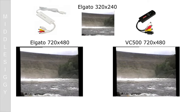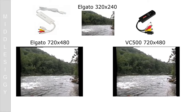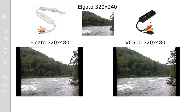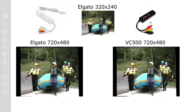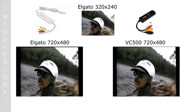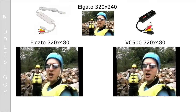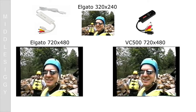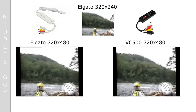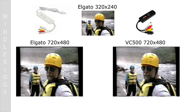Let's take a short look at the differences in the videos. We can see the native original 320x240 size and format of the video at the top of the screen — this is the original size of a VHS recording. The two videos below are the scaled-up versions for each device in their 720x480 capture sizes. These scaled-up videos are better because when we go to watch on our computer or big screen TV, the larger pixel image will hopefully look better and not so blocky when expanded to full screen. The Elgato software provides many more output options, as the cheaper VC500 really only has one format. I don't see an earth-shattering quality difference between the Elgato and the VC500, but I did notice the encoding process of the Elgato software definitely made some of the rough edges smooth, and I think this is because of the encoding software. Both did a good job of upscaling the original 320x240 video, but the Elgato used a more modern algorithm, which caused the digital images to look better.